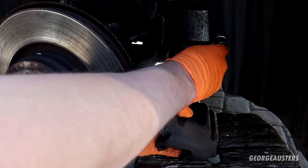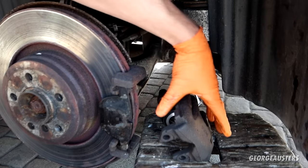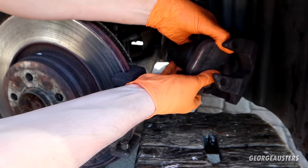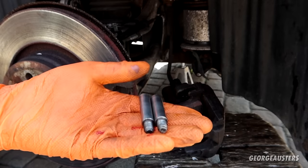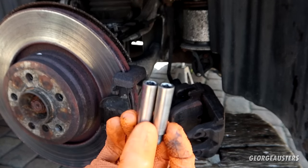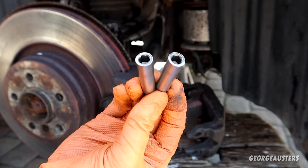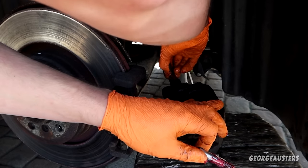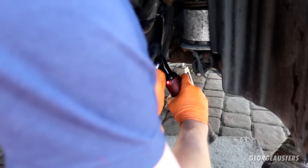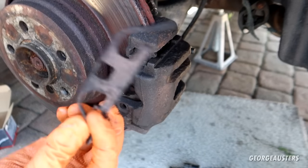Tying this down, reinstalling the brake pads. When it comes to installing the slider bolts, I've given them a good clean up. BMW actually recommends installing these dry, but I still like to put some red rubber grease on — I really don't see how it can hurt; it just helps keep things moving nicely. Make up your own mind. Slot these in, get the caliper back onto the caliper bracket, install the new caps, and then reinstall the securing clip at the front.